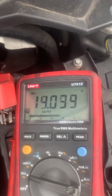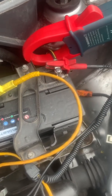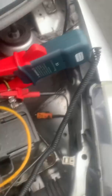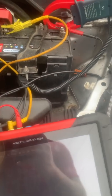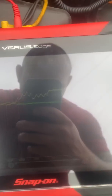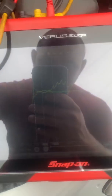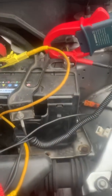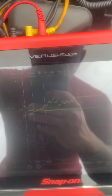As you can see it is bouncing around a bit but it is maintaining a charge, so we can move on to the next test. We connect our normal connectors and with the scope onto the battery using a high current clamp, we've got a nice long time base. We're going to crank it, start it, then turn all the consumers on and measure it. Yellow is battery voltage, green is current. We're looking to measure how much the battery drops during cranking, how much current increases, and what the charge rate looks like. We can use any oscilloscope - that's essentially what the Pico software is doing when you do a battery check.